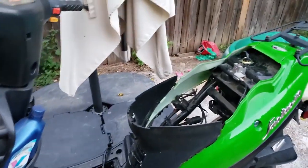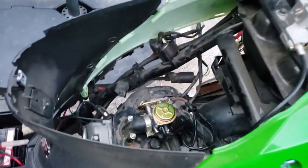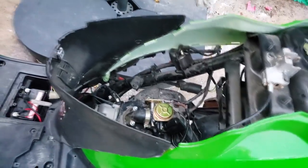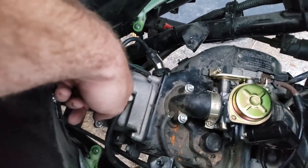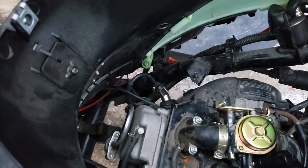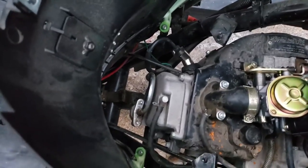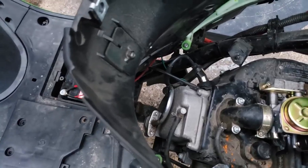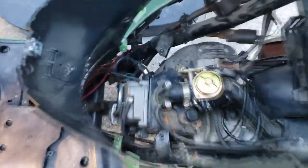The engine is about to stall out, and having changed the carb I'm not sure what else it could be. A lot of people talk about checking the valves on these. I've watched some videos — it involves taking the whole assembly apart and using shims that are three or four thousandths of an inch or millimeters to make sure the valves are adjusted appropriately. That looks like a more intense job than I was hoping for after all this other stuff.